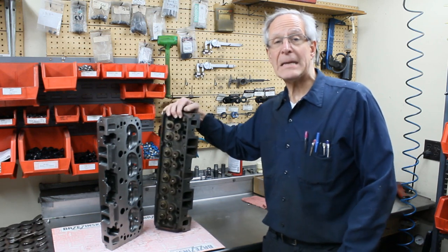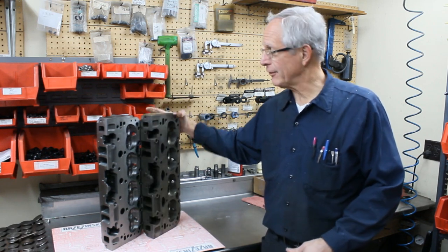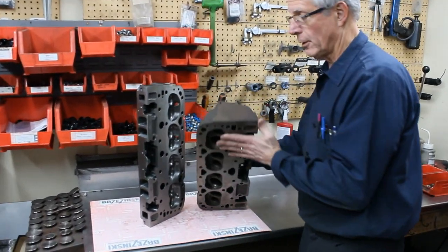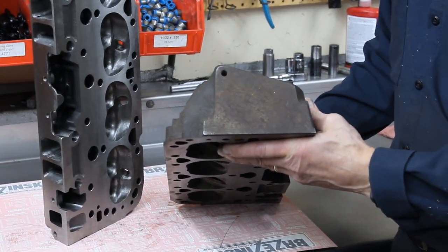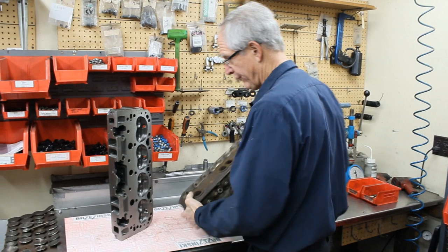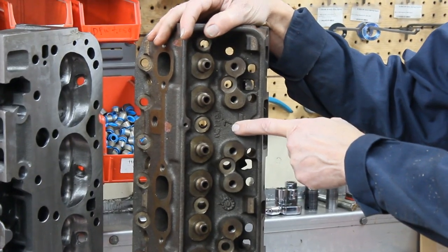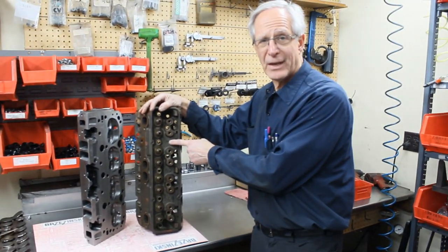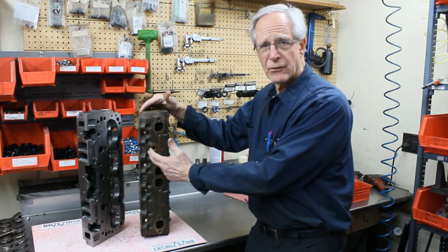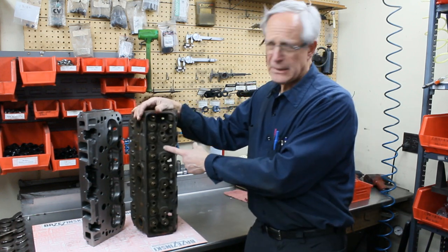Chevrolet changed who made the cylinder heads and went through some casting revisions. Somewhere in the mid-90s they came out with this new version silver head. It can easily be identified because it's fully machined on the end. It still doesn't have a heat riser, has induction hardened exhaust, and is machined for screw-in studs. It has a different mold number — typically anywhere from four to eight, with the more common ones nowadays being sevens and eights. These were a little problematic at one time because Chevrolet did some things with the cast-ins and they were cracking along the side — mostly the number five and six cast-ins.